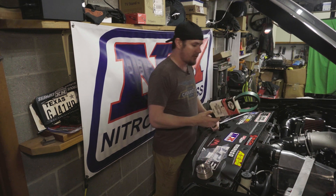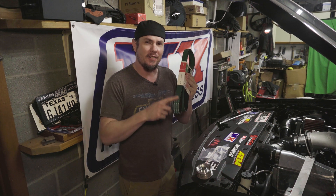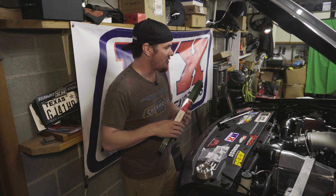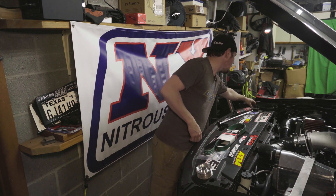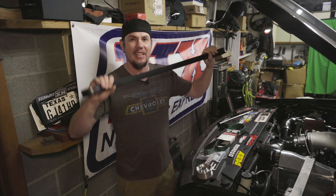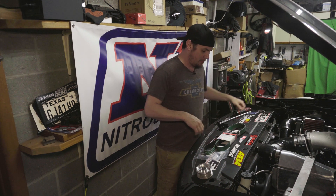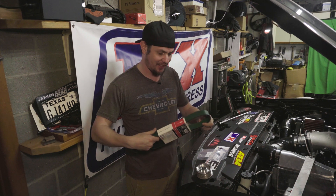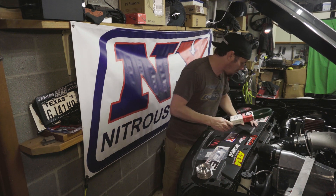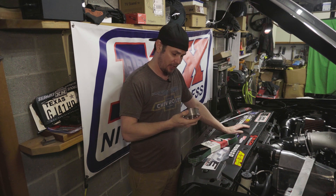I've got to get a couple things out of the way so we can swap the pulley out. We're also going over to a fleet runner belt — they're a little bit more resilient, about 60, 70, 80 bucks. The greenbacks: if you've seen high horsepower supercharged setups still running belts, you're normally going to see these greenbacks because they're more resilient than the standard automotive style. These standard black 8-rib belts are easier to find at your auto parts store once you know your belt length; finding the greenbacks in specific lengths is a little bit harder. This is a 710 — we're going from a 3.4 down to a 3.2 pulley, so this belt might be a hair long.